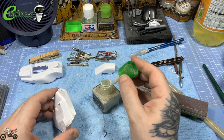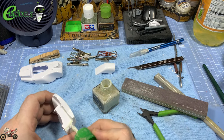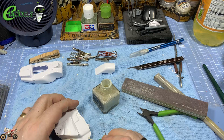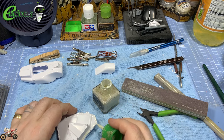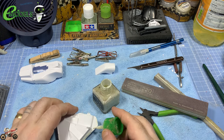And then when you brush it along any seams, it will just self-level, find its way in. And you're basically using kit plastic to fill the kit. And the secret of this is let it go off, let it cure. Be it one day, best, 48 hours, it ain't going to hurt. Then come at it with your sander and you don't end up chasing the seam around them.